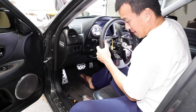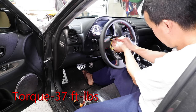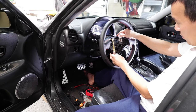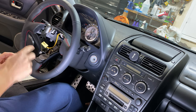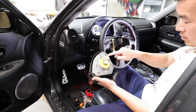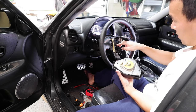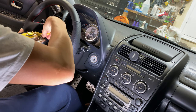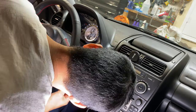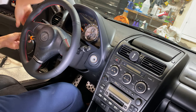Tighten it as much as you can — I'll post the torque spec in the description for those interested. Hand tighten it and make sure it's fully tight. Plug everything in and make sure the horn works. This floating contact piece is isolated from ground — when you put the airbag in, the back of the airbag grounds it through four metal contact points. I tested it by taking the wire straight to ground and it worked. Now just plug the airbag back in, press the two side screws into their holders, and tighten with the T30.